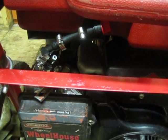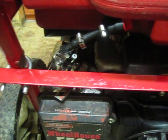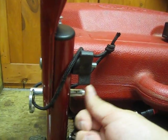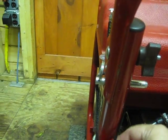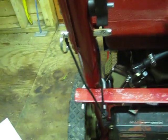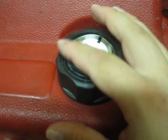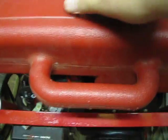I did a pressure test — got about 90 psi. I looked in there with a bore scope and there's no scoring, no scorching, so mechanically the engine was fine. Here's your on-off switch and kill switch. I replaced this hardware and this pin — the original pin was metric, so I had to drill it out for a 3/8-inch pin. Right here is parachute cord so you don't lose the pin. The nice thing is it also has a fuel gauge on the tank. I'll need to replace it in the future because the plastic is all clouded — it's about $20 on eBay.